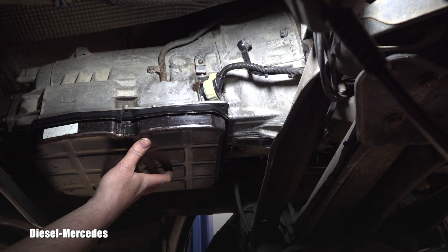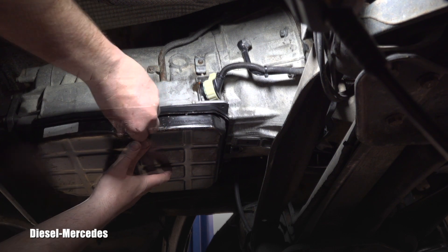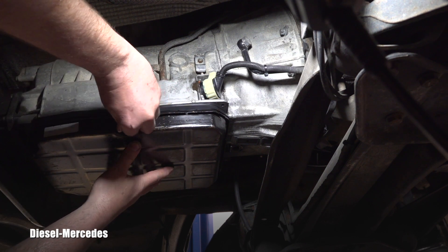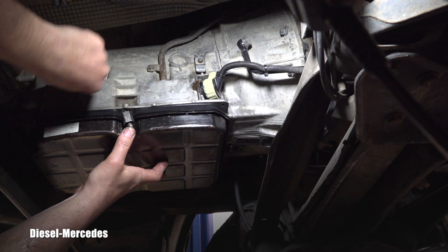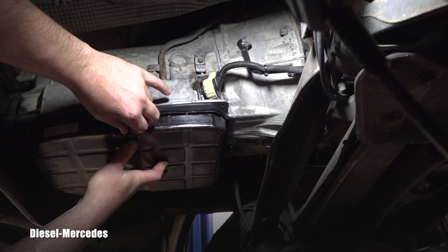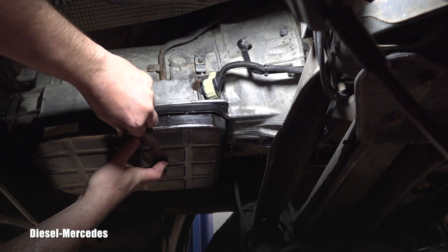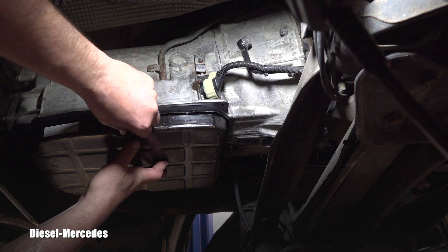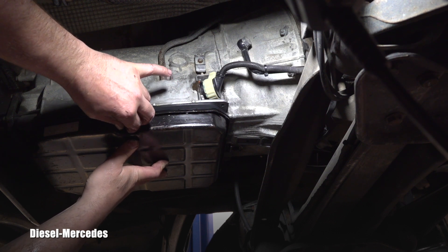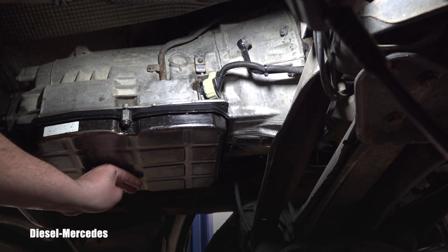I have the bolts with adapters ready. If you were following the video or doing it yourself, you might have been surprised during removal — you might think the bolts weren't very tight. That is actually correct if the previous tech worked properly. I believe the torque is only 8 Newton-meters, but you should recheck that. I never use a torque wrench on this; I go by feel after doing so many of these.